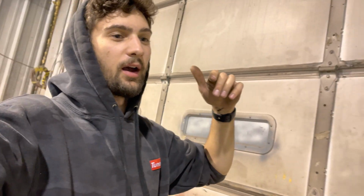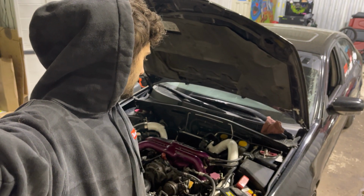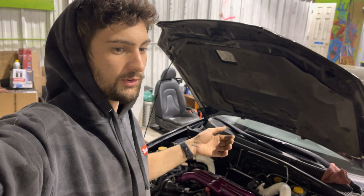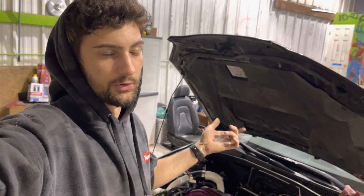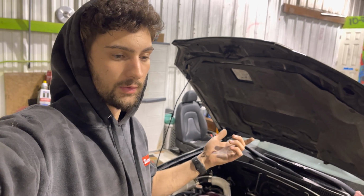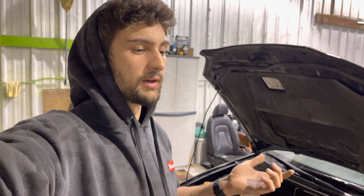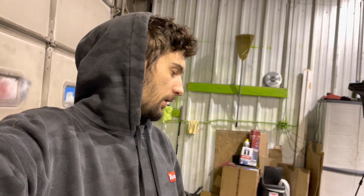I am back. I know that this video is going to get uploaded pretty much right after the one that I still needed to edit and put on with the motor out of the Legacy, which is now back in it. So I'm still using the same 20X, obviously. I got one of my buddies to weld the head for me, and we drilled it, tapped it, and again, it stripped out. So I put a thread cert in there, and it seems to be holding pretty good. No more exhaust leak. It is seeping a little bit of oil, but I can kind of live with it because it's dripped maybe a drop in the last 500-600 miles that I put on it. So I can live with that, no problem.